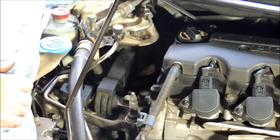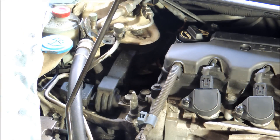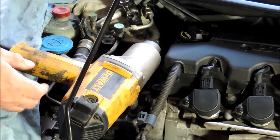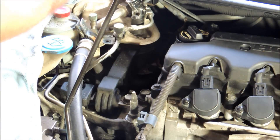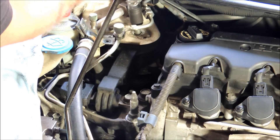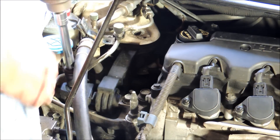Now we're going to take out three bolts using a 17 mil. We've got one, two, three big bolts to take out. I'm going to use my electric air gun with a short 6-inch half-inch extension, half-inch universal joint, half-inch drive, and 17 mil socket — you could use the 11/16ths. Check which way your gun's going before you put it on — always a good thing.